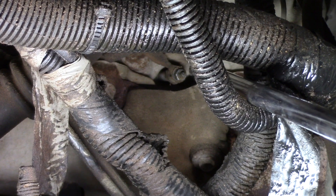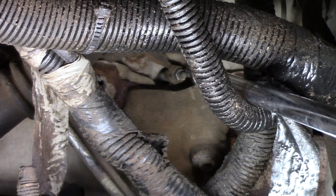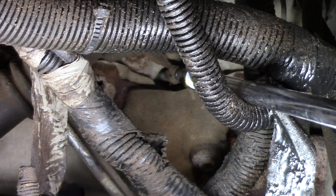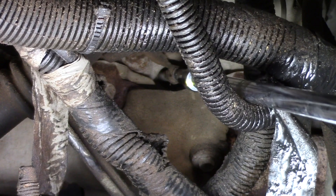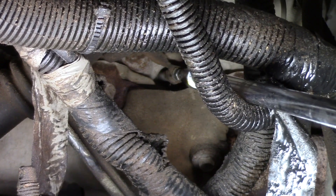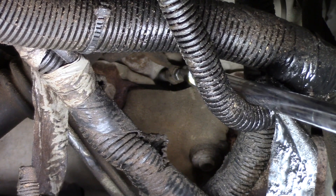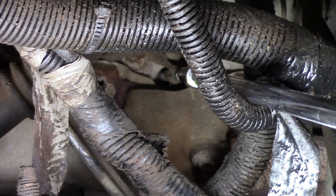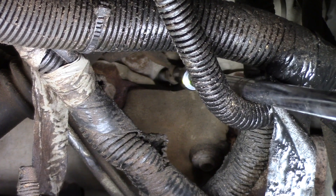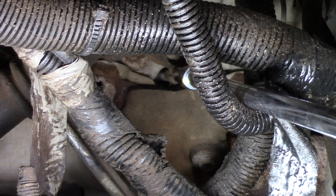Now that we have the fender lining out we can see the glow plug itself — I've got the tool rested up against it here so you can see as well. The first nut we need to remove is the pigtail retaining nut, which is the connection from the glow plug relay to the glow plug. In the case of this particular glow plug, the nut holding that wire is going to be an eight millimeter. Once we have that retaining nut removed we can then access the glow plug itself and start working it out.